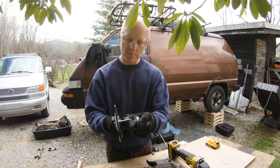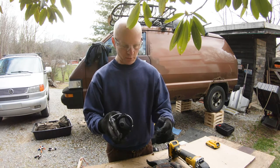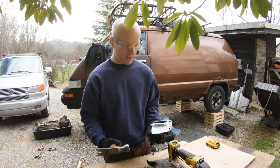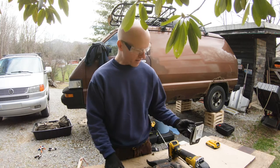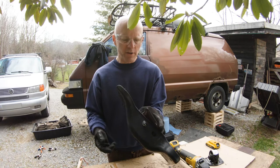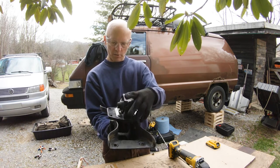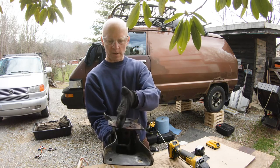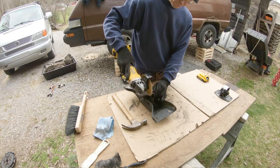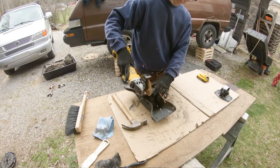This is my replacement one ordered from Toyota directly. But the internals of this is steel — it has fused to that bolt. So I've literally taken a hammer, I've taken my impact driver, I have done everything I can possibly do to try to beat this thing out. So what I'm going to do to remove this is cut through the top plate to where I can clear enough space to get in there and cut through and basically break the bolt off. Get ready for some sweet slow-mo.